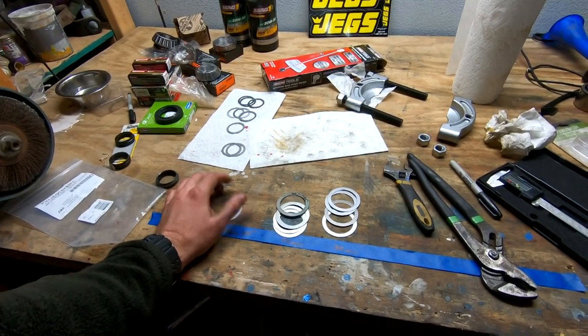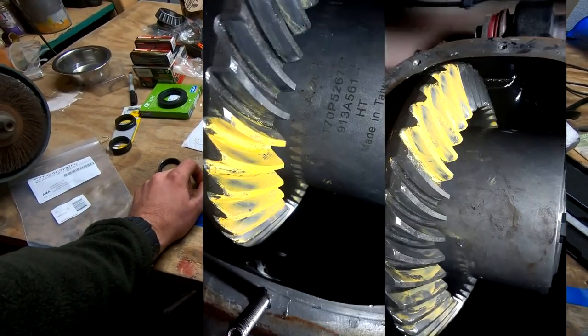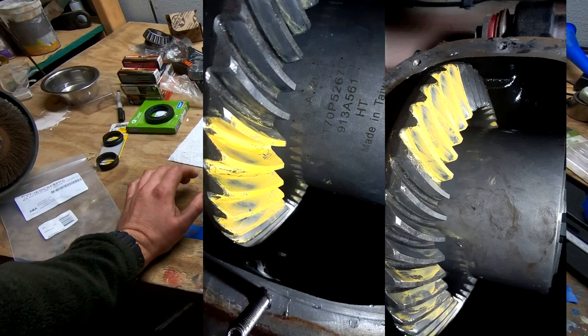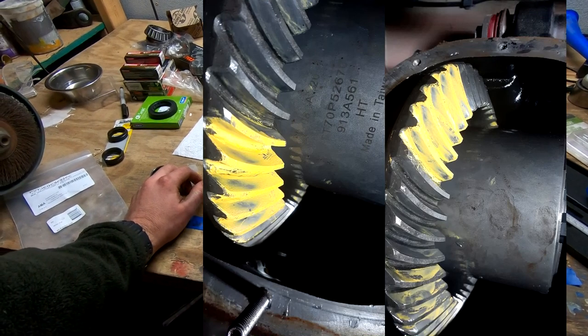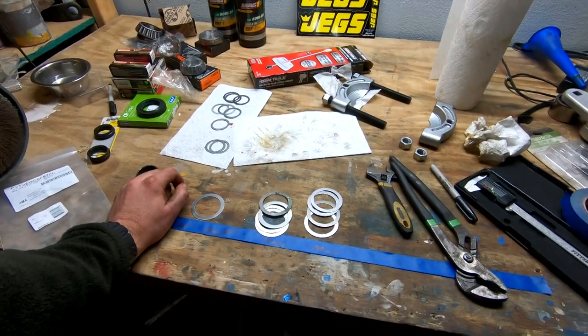Went ahead and used a smaller shim than factory, went down to the 0.50 size shim, popped that in there. And mind you, backlash is not perfect in this setup until we go back to the original ones. I'll have to adjust that. But again, it moved the coast side now out instead from the center, and the drive side honestly looks the same as the first picture. So upon further inspection, I'm going to pull out the gears in a minute.